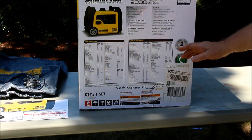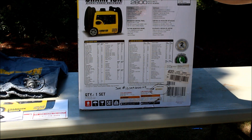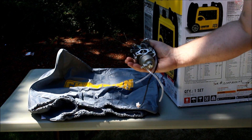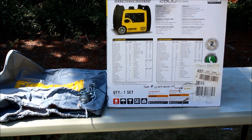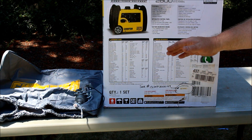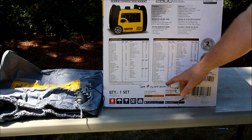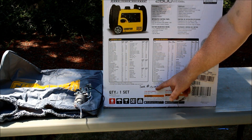The generator is surging and I bought it a week ago. I called Champion and they were really good with customer service. They sent me a generator cover and a new carburetor, two-day air, and it came in two days. The only thing I could figure was that this thing had sat for a while with gas in the carb and varnished up or got debris in it somehow, and the tech I dealt with on the phone seemed to agree. The serial number on this unit is dated 13 September, so I'm figuring it sat — it's now July of 2014.